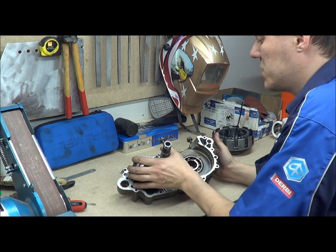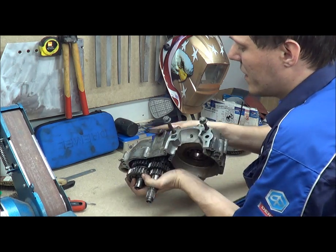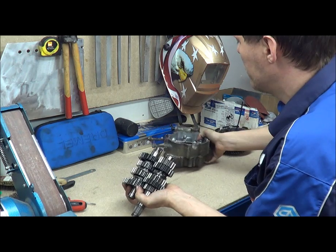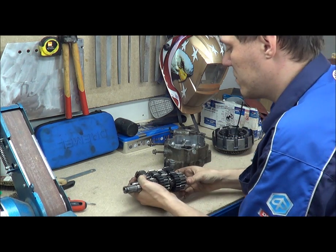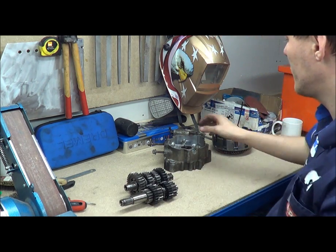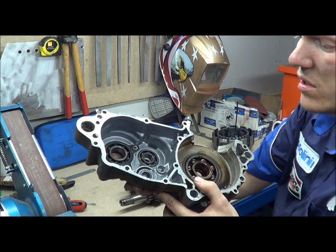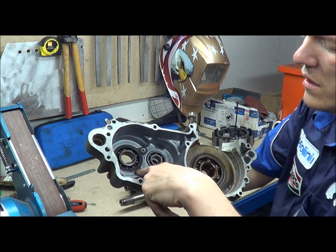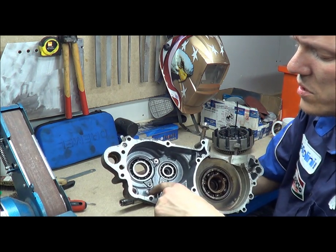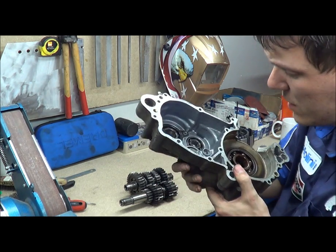So when you come to split an engine, all this will be clustered together and linked together. If you just turn it upside down and pull out, the whole thing should all come together — there's bits you can cable-tie together. Then you just lay it down, and literally that's it. There's just some bearings, they're housed by these clips, and then a needle bearing for the drum, and some — not even bushes — they are literally just drilled or milled straight into the arm in your casing.